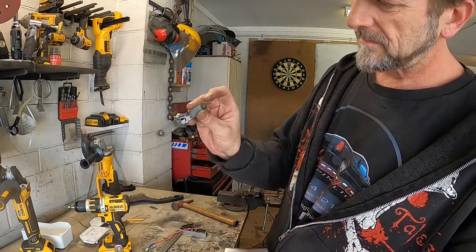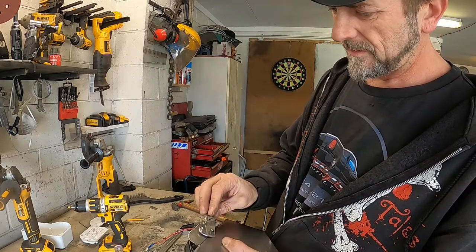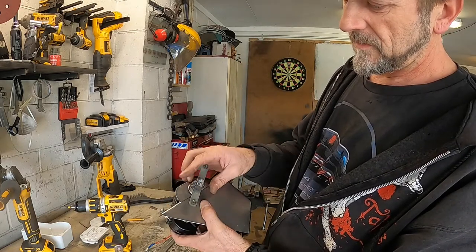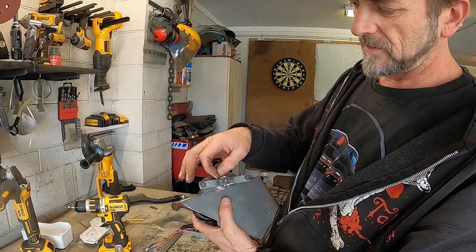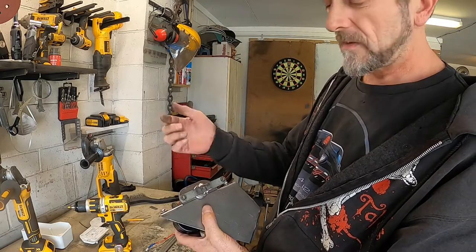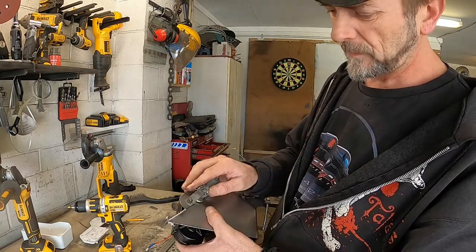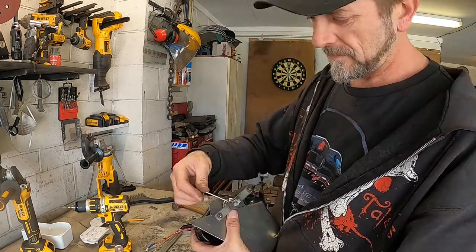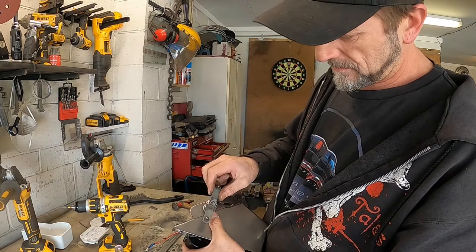And so here's my little arm thing that the factory part welded onto the nut. Not too pretty, but it's tucked up under the dash, so that's just going to sit on that shaft like that, and once I figure out where my park positions are, I'll be able to tighten up these little grub screws, mark where they need to be, and then I can take this out and drill a little divot in there and chuck some Loctite on when it's in final assembly. That will just pinch up like that, in theory.